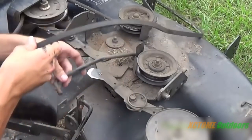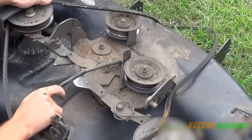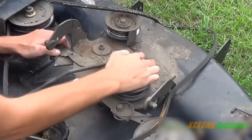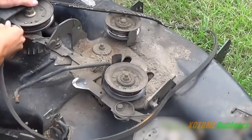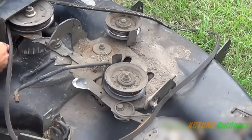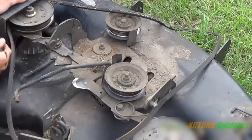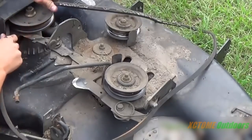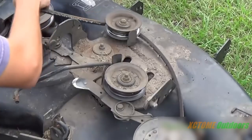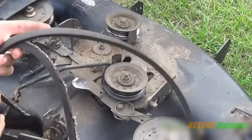Sometimes you have to take this bottom rod out — pull this little tiny pin. You don't have to take it all the way off. There's a little guide right here. Pull this back, then you're going to get the belt off. Now that it's open, you're going to get the belt off from back here. I'm going to try to get this off without taking this guard off. Got it — that's how you do it.